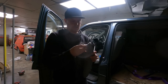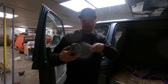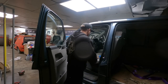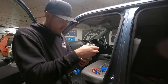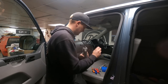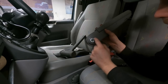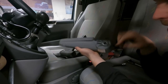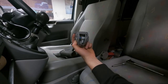Once you've got to that point, this bit will still be in here. I used a half-inch extension bar into the smaller side, hit it on the floor, and that knocks that piece out. Get the new piece - there's a metal spring thing in there that you've got to get this over - and push the new one in to place, flush both sides. Screw the adjuster back in. Once the pin is in, wind it all the way in with a screwdriver as tight as it will go, meaning you can't turn this by hand.